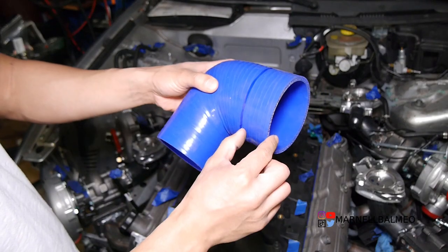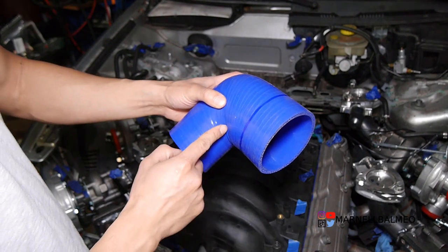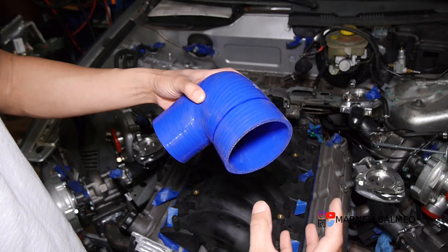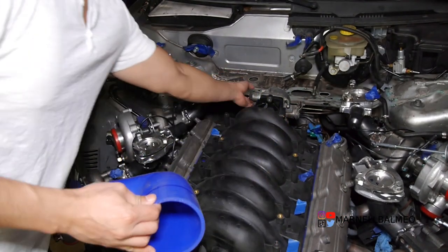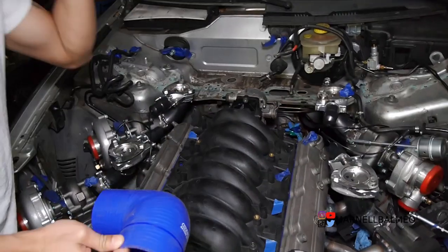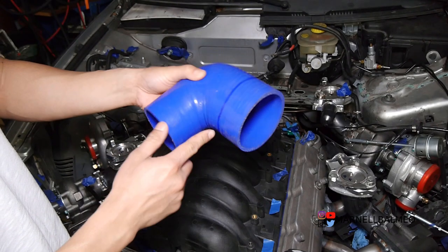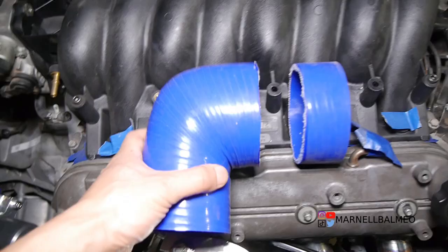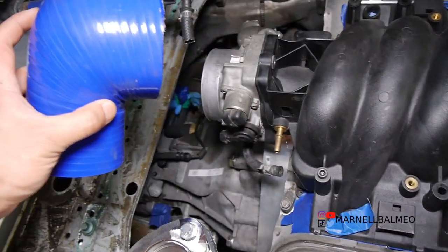This is a bit excessive. Preferably, if I had the space, I'd want as much straight piping into the throttle body as possible. But because it's a tight space in this area, and not really knowing how much clearance I'd need at the bottom, I'm going to go ahead and trim this out about this much. With it shortened, let's go ahead and put that in place.